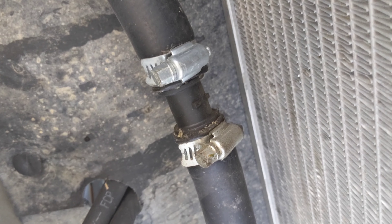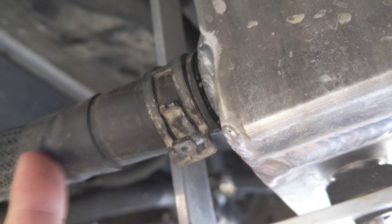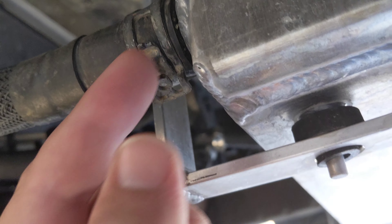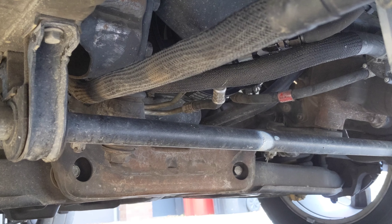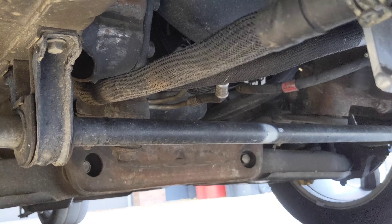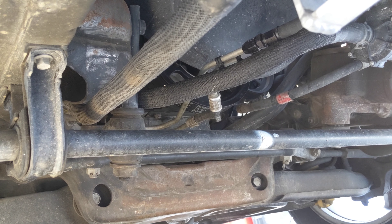Since I put a different heat exchanger — this is the LFP heat exchanger — it goes through that fitting and into the top of the heat exchanger. This is a dual-pass, so it goes down and back and comes out right here. The somewhat cooler coolant then follows that line back up to the intercooler under the supercharger to start all over again. That's basically how the system works.